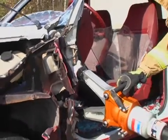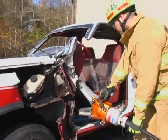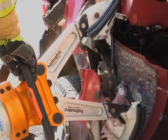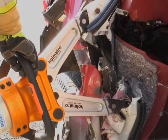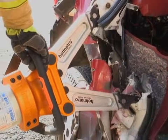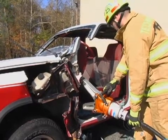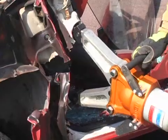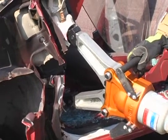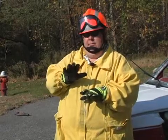The nice thing about a dash lift is, as that dash lift goes up and we put force underneath that dash reinforcement bar, because it's high tensile strength material, as it bends up, it stays bent up. Whereas in a dash roll, when we make our relief cut, the dash comes right back down if the ram slips or our cribbing slips as we go. Key note here: make sure your cribbing is solid underneath the A post to help facilitate that lift right away.